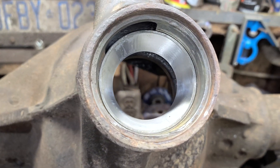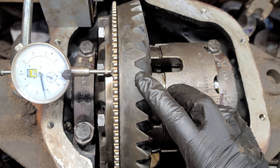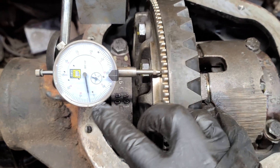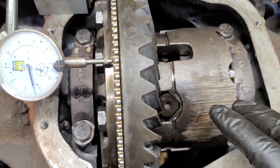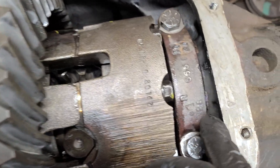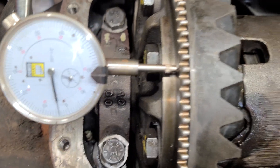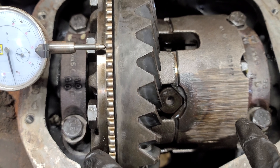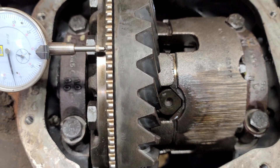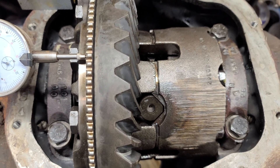I've got the carrier in here and I'm trying to take the backlash out and get a little bit of preload. When I shove it one way it reads zero; shove it all the way the other way, I've got about six thou of play. I'll pick up the edge of the bearing and shove it each way, then put about three to four thou of shims on each side so it shouldn't just drop right in — I should have to beat it a couple of times. That'll be a proper carrier preload.